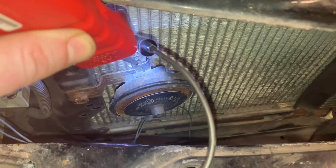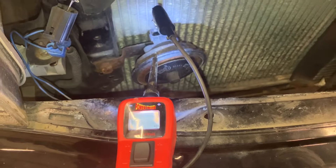So here we go — I'm just going to press that contact. It's showing continuity. Here we go — perfect. So with battery supply voltage direct on the horn, the horn's working.